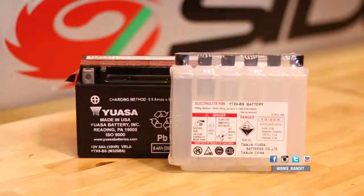So now you know about lead acid, AGM, and lithium batteries and their strengths and weaknesses — let's get to the most important part: which one is right for you? Lead acid batteries are like your grandpa's pickup — nothing fancy, but it's paid for, it's been around forever, and it will always run as long as you take care of it. If you want a battery that will work reliably and save you money, and you don't mind the weight and a little extra maintenance, traditional lead acids are for you. Just remember these lose power the fastest of all battery types, and we strongly recommend a float charger like a Battery Tender Jr. to keep it charged and running strong.